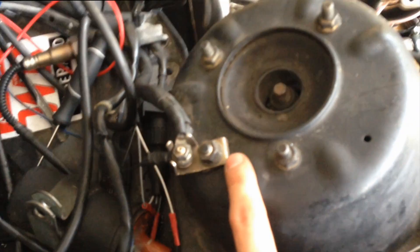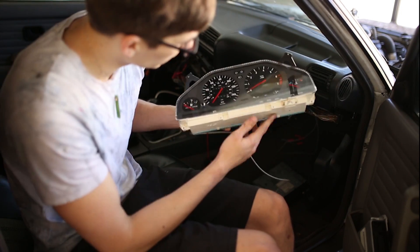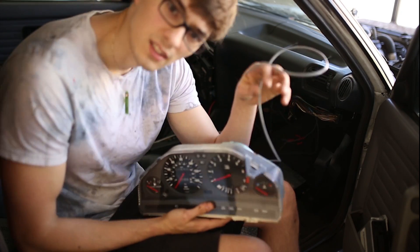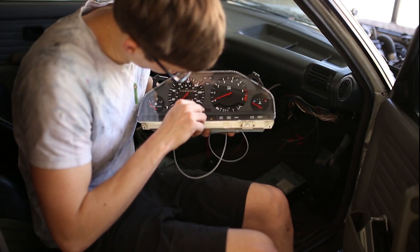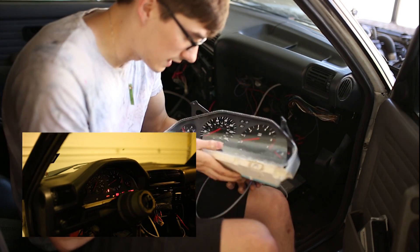This is the actual point where the ECU grounds. I ran over and wired in a 12 volt switch from the fuse block on this side with an inline fuse, and that runs over there and into the firewall. So I'll pretty much take this opportunity to show off my handiwork. I've installed that little screen unit from the wideband system into where the check light was.